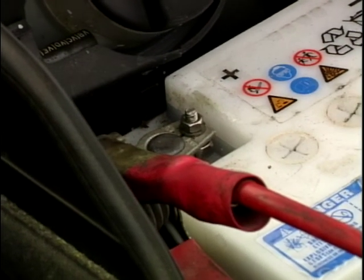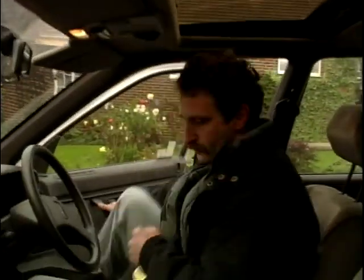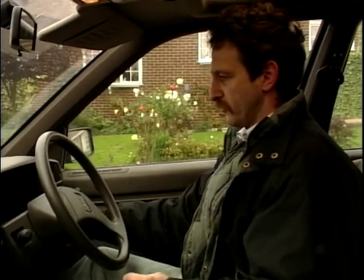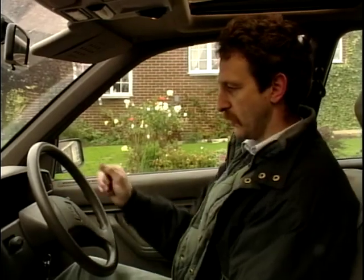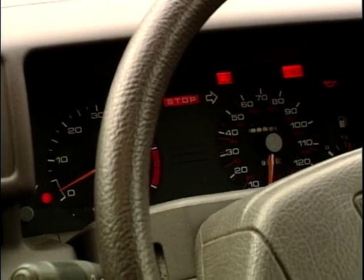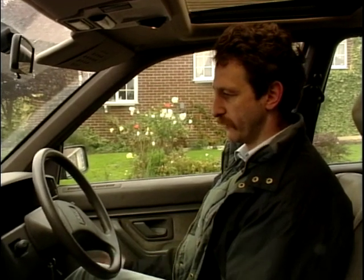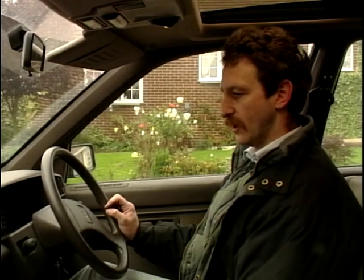That's it. Right, now this boomer should start — we'll see if it will. Now we've got the two batteries lined up. You can see all the lights on the dash are now lit. And with it being a diesel, I've just got to wait a little bit until the heater plugs have done their bit. The heater plug light's gone out and there we are — what a difference that makes. Now I'm going to get out and disconnect these battery leads and we'll take it into the garage, test the alternator, test the battery, make sure that's the problem and get it fixed.